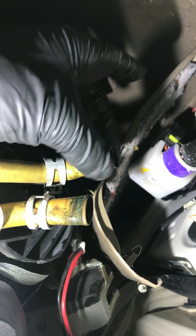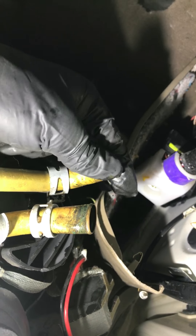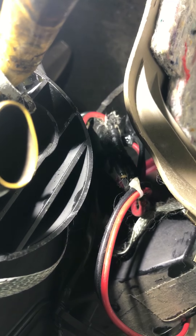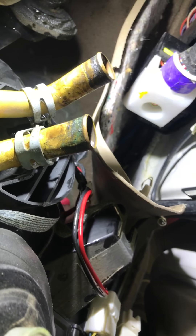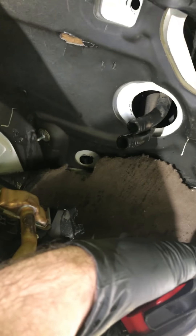There's the finished product. Be very careful when you put the new ones on — put some silicone around them when you slide the hose on. Because if you put any tension on these — like with pliers or whatever — they're made of brass, and it just squeezes and bends really easy. I barely put any tension on this old one and it deformed. If you don't have a good, true, round circular shape to match the hoses, you're going to have a leak after you throw this all back together.